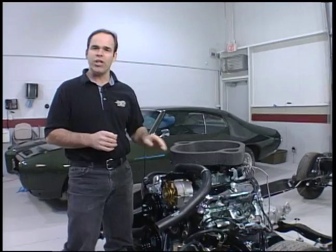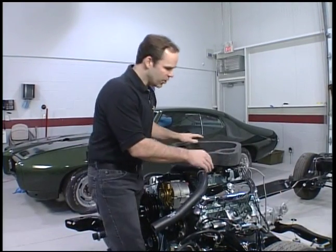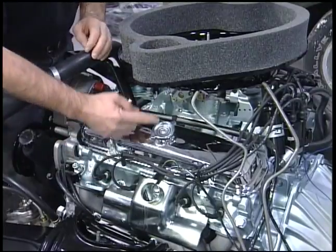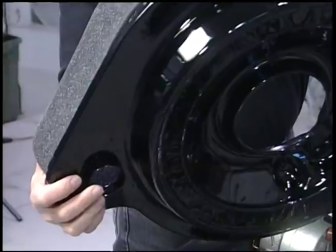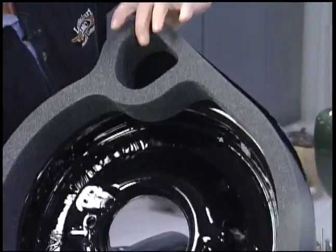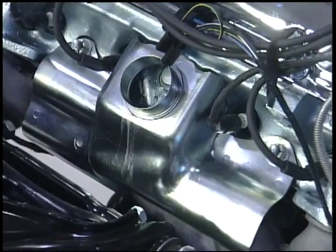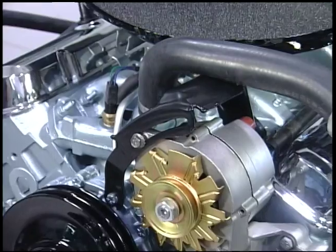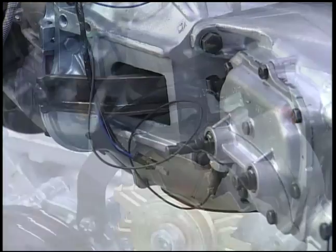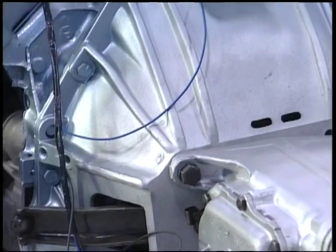As far as the differences between a Ram Air 3 and a Ram Air 4, the air breather looks very similar, but you have a pre-heater tube that comes down from the exhaust manifold up into here on a Ram Air 4 car — it's on both sides. Ram Air 4 again has this piece here; it's hand formed, this one's metal stamped. As far as the brackets go — you remember how we dipped them — those are all correct. The overspray on the bell housing would be correct; keep in mind they were sprayed originally together as one unit.